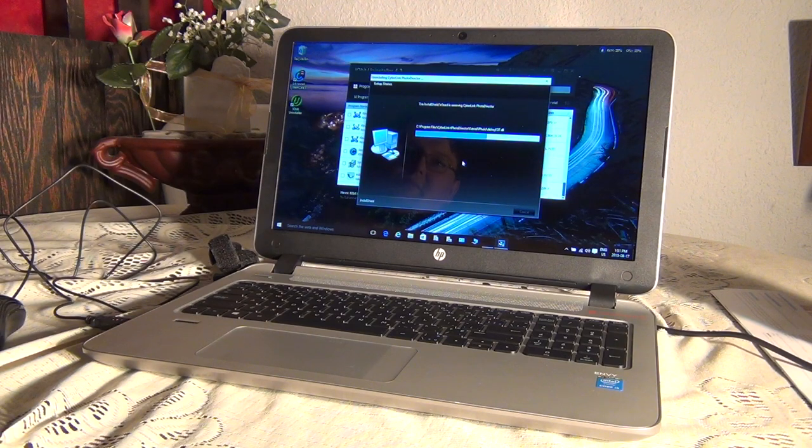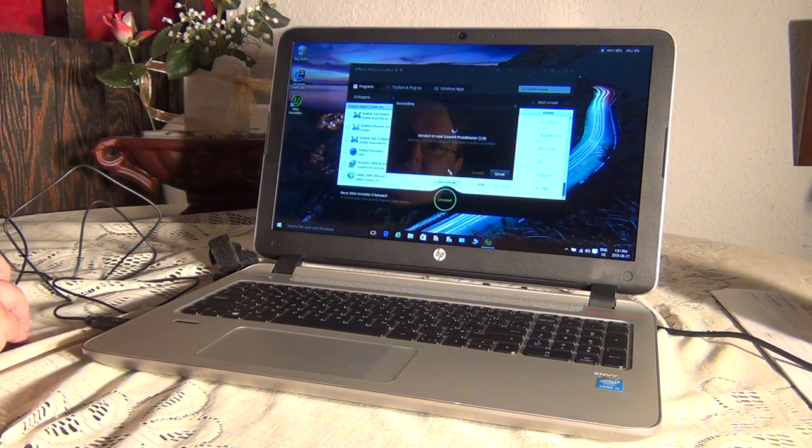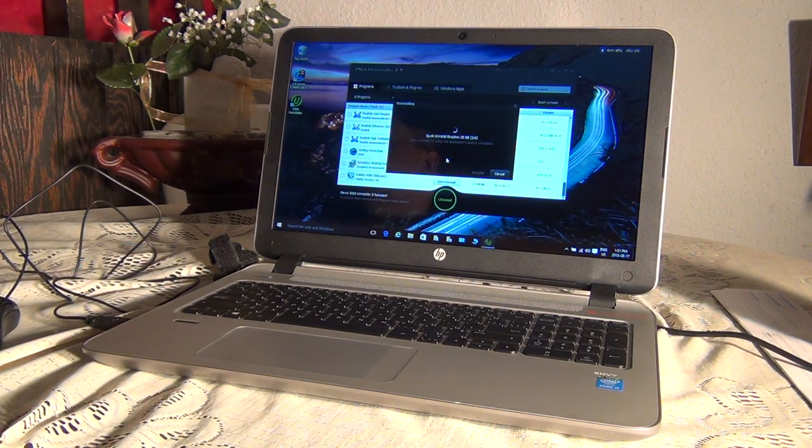The other good thing about this program is it does what they call a powerful uninstall, where it actually gets all the registry entries and leftover files and folders gone too. Some programs are really sloppy at leaving stuff behind after they uninstall. A lot of times they only uninstall things that were installed when they were first installed, and not the profiles that they created in the life of the program.